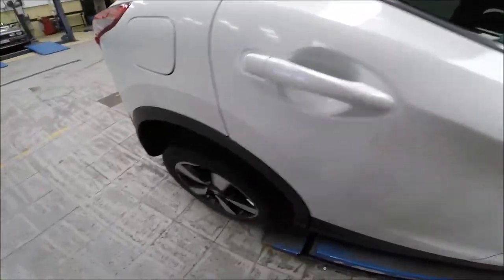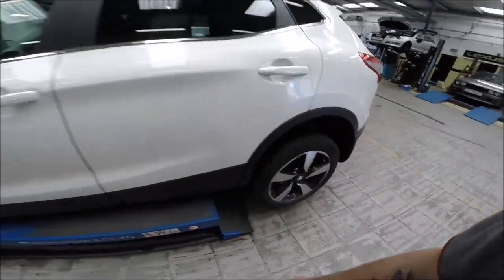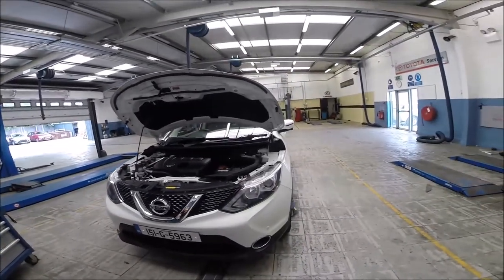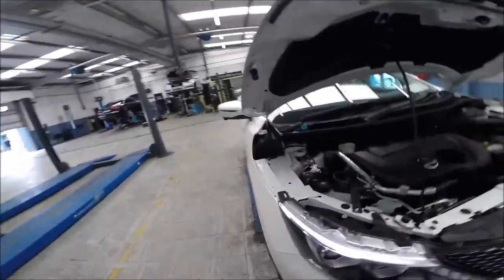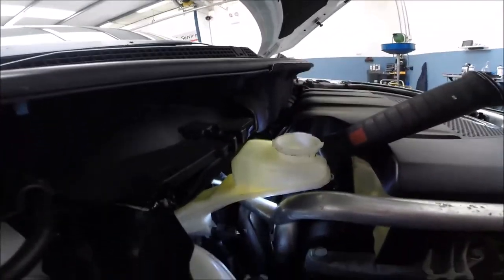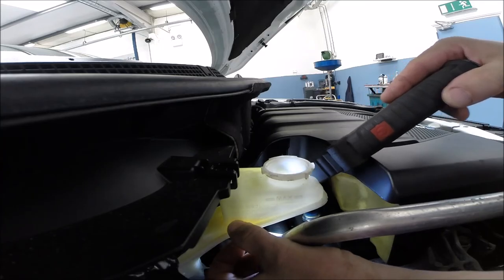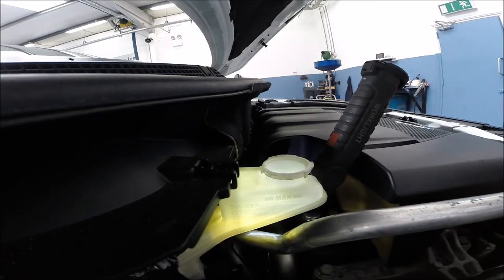Happy day. After adjusting the handbrake from the button, it will be a good idea to check that everything plays free. And the last step, when the car is on the ground, adjust the brake fluid level, of course. Okay, lift is slowing down. Okay, we are down. So now we have to check what's happened with the level. Where is the level now? Okay, so like you see, the level is a little bit higher. It was actually here, now it's here, so not much up. But it will be a good idea if we adjust this, so we add the fluid.